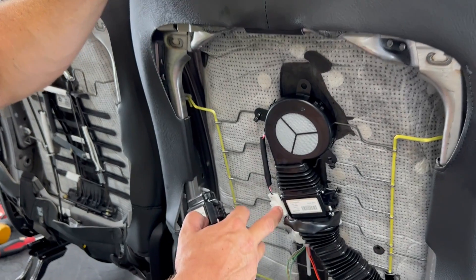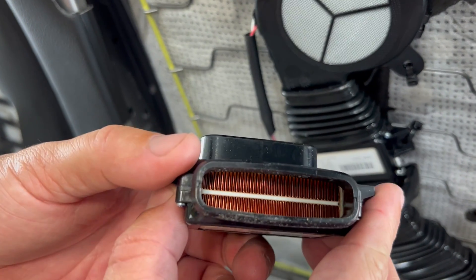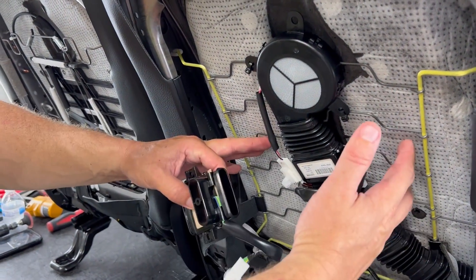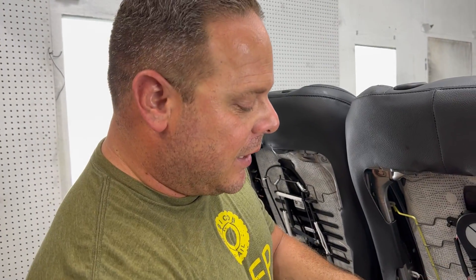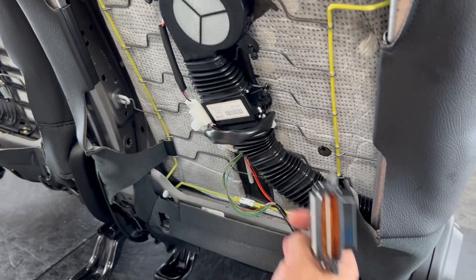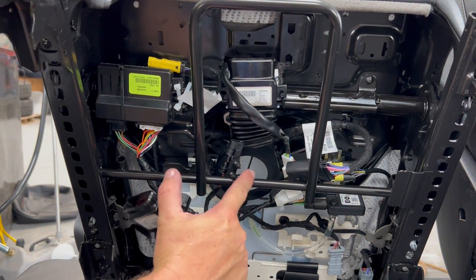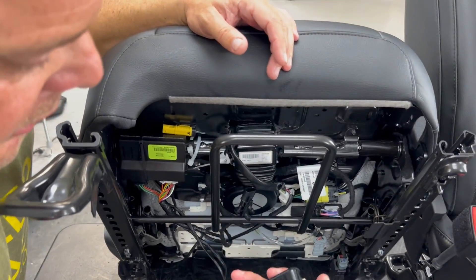This is your fan. You power the fan and then either heat up or cool the TED - it's like a little brass radiator with fins. The fan blows air through it and distributes it to the back and bottom of the seat. If you click cool, this unit cools off and literally blows cold air on your back, butt, and legs. When you hit heat, it actually heats the unit and still blows hot air - not just heating elements. The fan, TED, and hoses all plumb through into the seat.